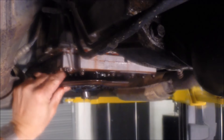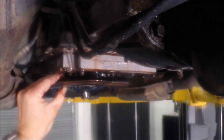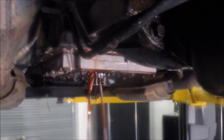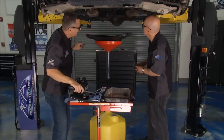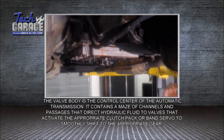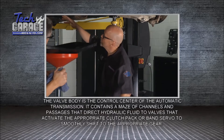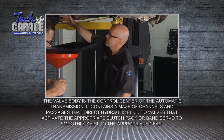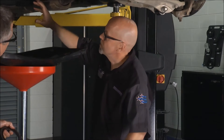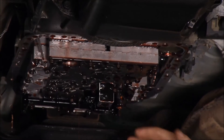I'll just use my enforcer and try to pop that filter off. Once again, without taking a bath. Come right out of there. There are some solenoids, some valves, some pressure valves inside of that transmission that can fail. New and modern transmissions have these solenoids, and if you get harsh shifts or slow going into gear, these might need to be replaced. Yeah, we sell all that at rockauto.com.